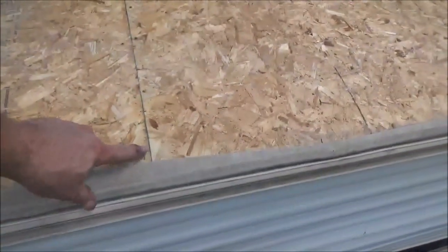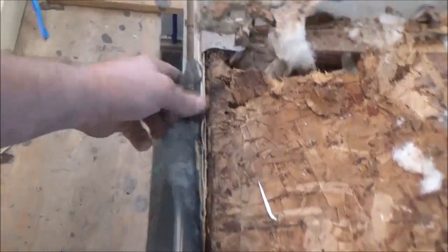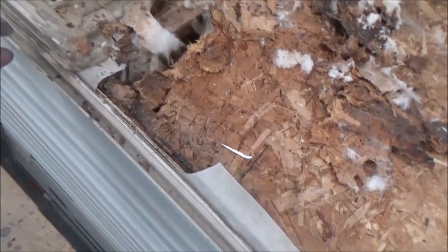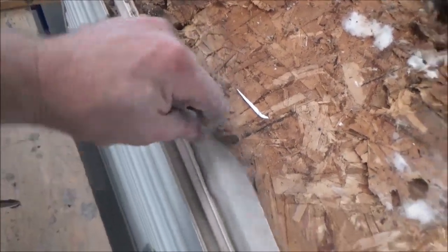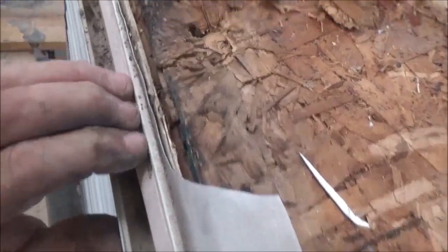Sometimes along here there's a band right there. It's a board that runs all the way down, and that's what cinches in these trusses. Here's a truss right here, and that band goes all the way down and kind of connects them, like a band joist on a deck or something. Actually, some people call them ribbons, but it's the same idea. Then also the purpose of that band is to screw to. This is the turn bar right here. Roofing comes down, as you can see, it goes under there, and then there are just screws right behind here, in this piece.